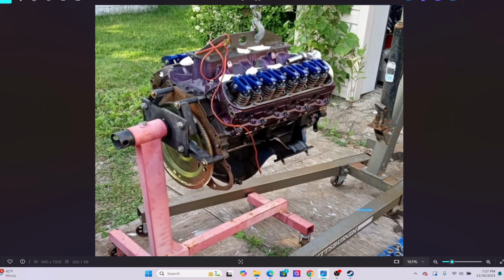So what you do is once you have the bell housing mated up and everything, on an AOD in particular, you can get to it through the starter motor. But essentially what you're doing is you need to have the torque converter able to move back and forth off the pump. Like, I want to say you don't want more than like an eighth of an inch. I'd have to look at my instructions again. See, everything in these last two videos is like, I don't remember anything, at least specific measurements, but that was how I set it up.